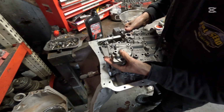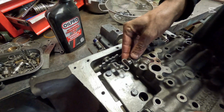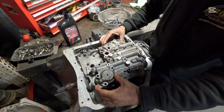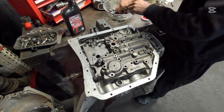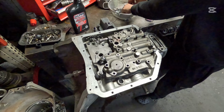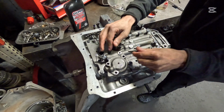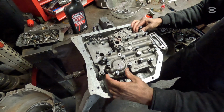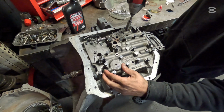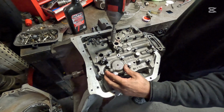I just have to hold it with my 2 fingers there. I'm going to drop that in just like that, and then make sure our S-link connects to our rooster comb over here, just like that. And we're going to make sure our valve body is up above before we drop it. We don't want to rip the gasket. Bam. Now we're going to add our bolts in and tighten them all down. And you want to make sure you tighten these two and these two first, or you'll have your valve body in a bind and you're going to chew up some threads if you're not careful. I like to wiggle it just to make sure everything's in there right. You can hand start some of these. You're going to take your gun here and just walk this down. I think that's a little bigger than it should be, but it's okay.